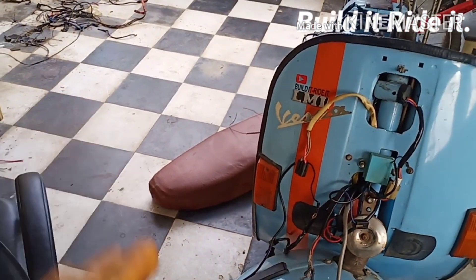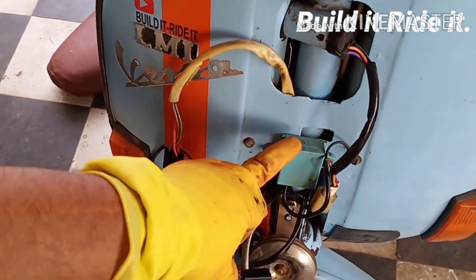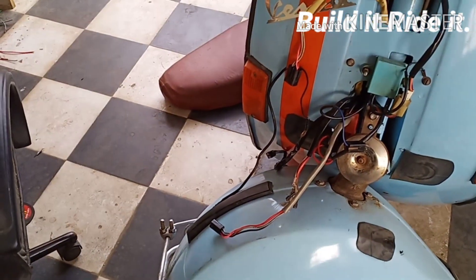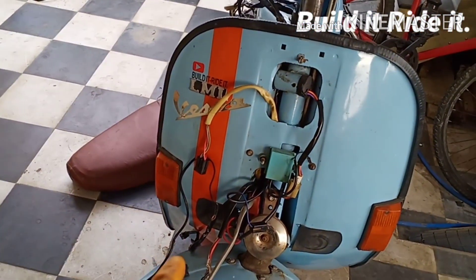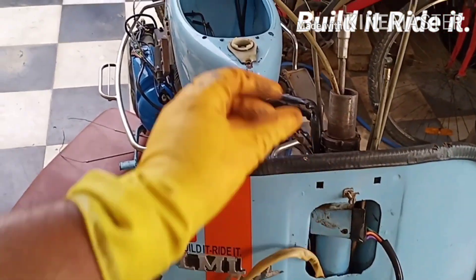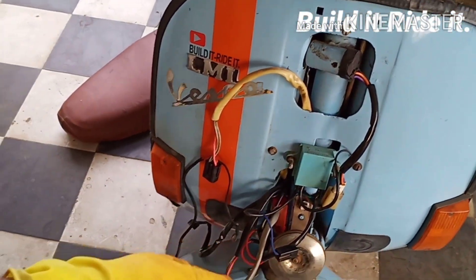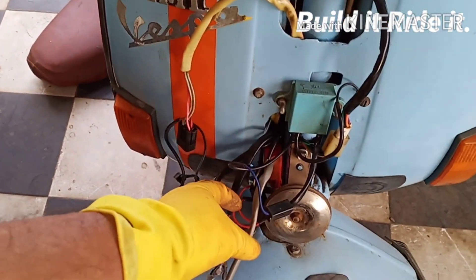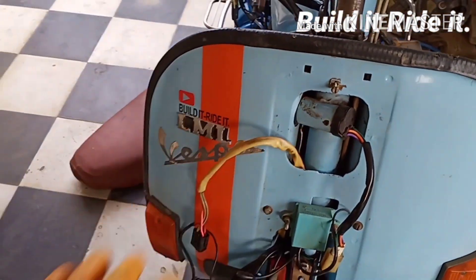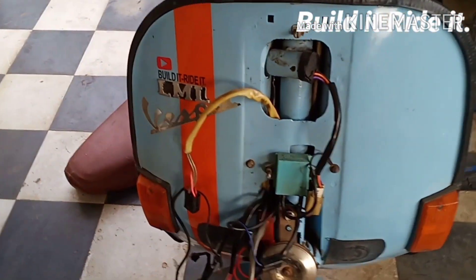Finally we took out all the cables from the top part and installed all the equipment — specifically the horn adapter, the horn, and the PRD relay on the scooter. One important thing I'd like to elaborate: before mounting these pieces of equipment, you have to make the cables pass through this area and come upward. Otherwise, every time you'll have to remove the PRD relay or any other equipment just to get better access. That's what I really wanted to emphasize.